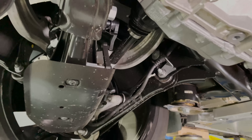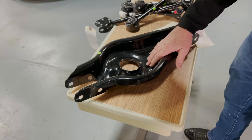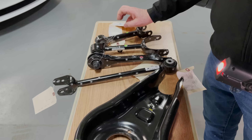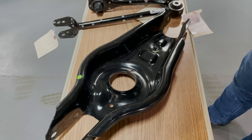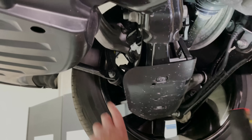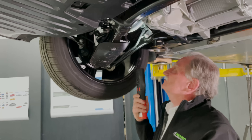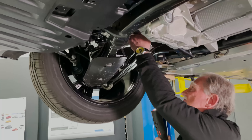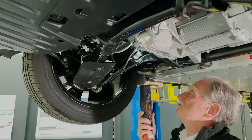Let's look at what Tesla did. Where you saw that one steel piece, this is where the spring sits. Tesla has four simple, easy, cheap stamped parts that make their five-bar link. I don't know why — normally I would expect to see something like these castings if I was looking at a legacy product, not a new product. This is a brand new design. I don't expect to see something as expensive as that semi-solid forged link here — these are things you should be able to design out.